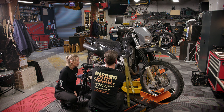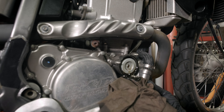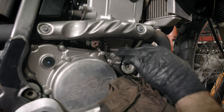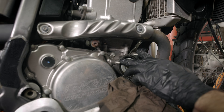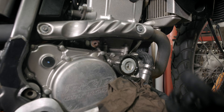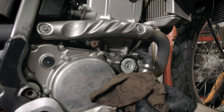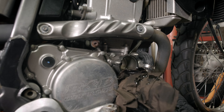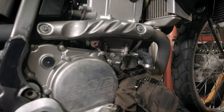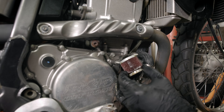So while we're doing a full oil change here we're also going to have a look at our oil filter. Inside here we have the cover with the spring. The spring is going to push the oil filter into its little home inside there. You'll also note on the outside here there's the gasket — the o-ring. When we're doing this we're going to be inspecting the o-ring, making sure it isn't broken and still looks quite good with no signs of wear. It's a good periodic maintenance thing to keep on top of. The filter is what's in charge of filtering all the sediment, particles, and stuff inside your engine oil that you don't want cycling through into the engine — so it's going to come through the oil filter and then into your engine.